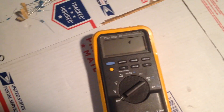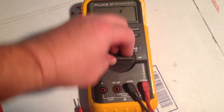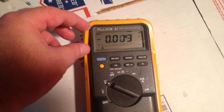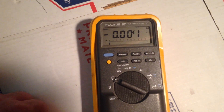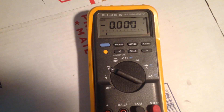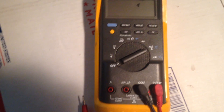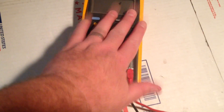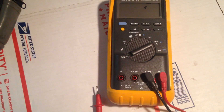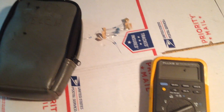The only thing I did have with it — some of the digits on the display were a little faded. All that required was pulling the LCD screen out, cleaning those contacts on the board, and putting it back in. Now it looks perfect. The board itself is clean, there's no corrosion — no corrosion on the battery terminals or anything like that. So it's good to go.